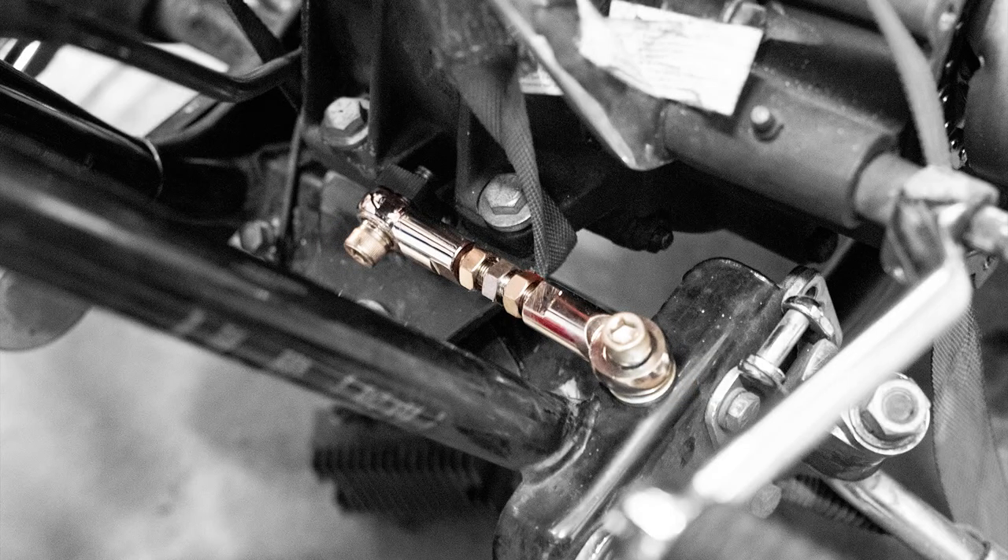The whole name of the game here is to adjust the upper and the front stabilizer links on the motor. The upper link is down under the gas tank, and it connects the top of the motor to the frame, and it controls the vertical alignment of the motor. The front stabilizer is down behind the front wheel, and it controls the horizontal alignment of the motor. So ultimately what we're doing is setting both of those so that we get correct tracking on the bike.